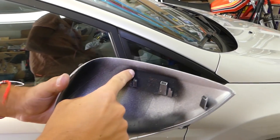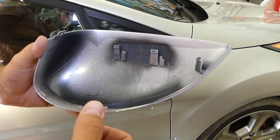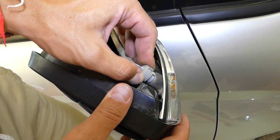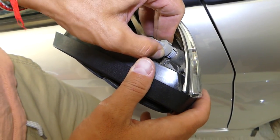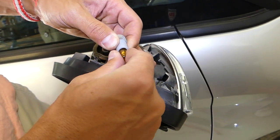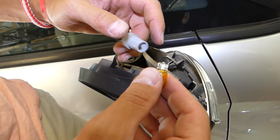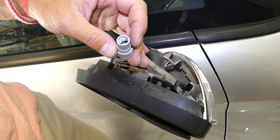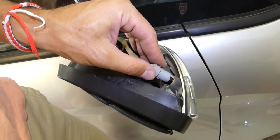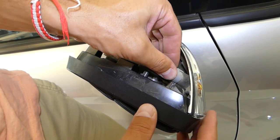The other three clips are right here. Once you remove the cover, this is the light bulb right here — you just gently pull it out. After that, grab the bulb and don't turn it, just pull it straight out. The bulb number will be listed in the description below. Get the new bulb, push it in, and make sure the seal is all the way in.